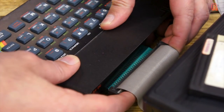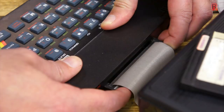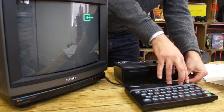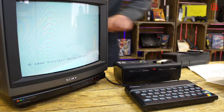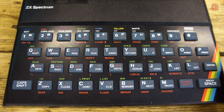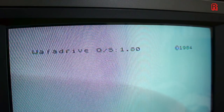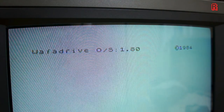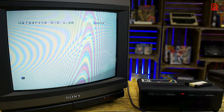If you have other peripherals dependent on the same ports, it provides additional ports on the rear of the wafer drive for printers, modems, etc. Plugging it in, at first glance really not very much happens — it boots quite normally, because we first need to initialise the drive. To do that we use the New Asterisk command, typed on the terrible spongy keys of the Speccy. As soon as we press Enter, the Wafer Drive Operating System, or WOS, kicks into life from an onboard 8KB ROM.